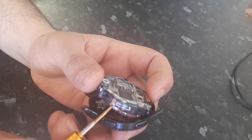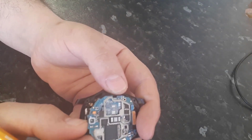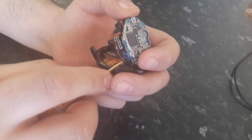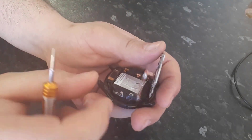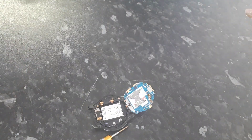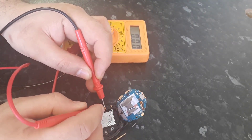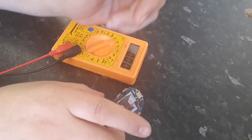The first thing is to check the power button contact. You can short these wires with a tweezer. But let's check the battery — let's see how much charge it has. What you need to do is move the button from here. Let's see how much voltage, how much power we have in the battery. With the battery connected, we got nothing — we got zero volts.